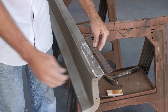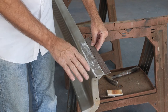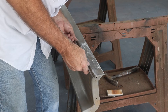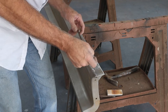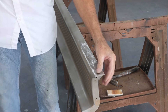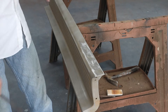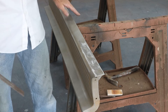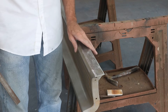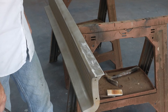Let's hit it with the sander again and see how it looks. We'll lay a straight edge along right here — that's perfect, so that's great. Along here looks really good right on the roll. I'm looking for any unusual high spots, and I think we're going to rough this up and put some body filler on it — that should be good to go. The other dent we already took care of; it was just a little bit of a roll dent. Maybe a big boy stepped on the running boards and put a little tweak in it. Other than that, this is about ready for body filler.